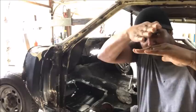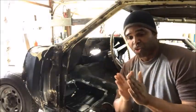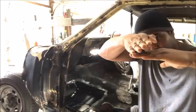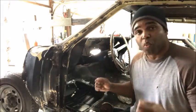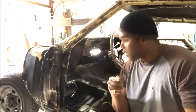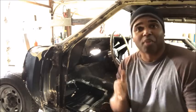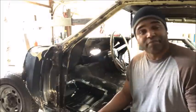Old metal, new metal. What I'm going to do is score it some more with my grinder, but I'm going to grind it on an angle — because if I come in straight, it's going to provide too much space with no room for error and you've got to be pretty perfect with that. Coming in on an angle will leave a little bit more material to grind for a perfect fit, whereas the other way there may be nothing to grind and I'd have to add metal.